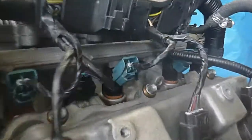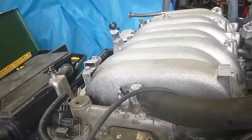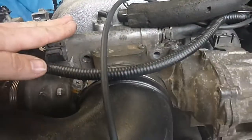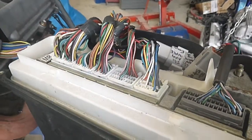Injectors — this is an early 3UZ with pink injectors which are the same as the 1UZ. Same intake manifold, and I've changed the throttle body and then clipped on the 1UZ management that's out of a 171 Crown, and it'll just make it go.